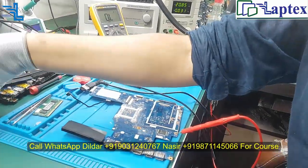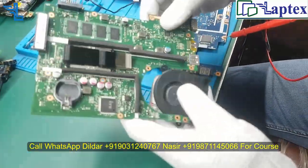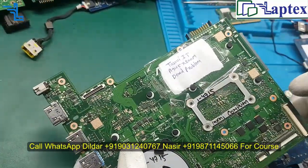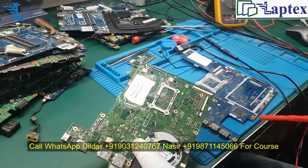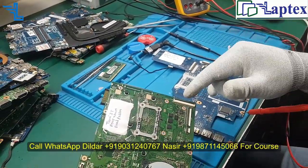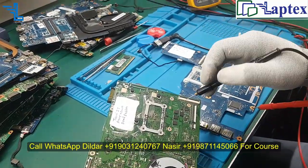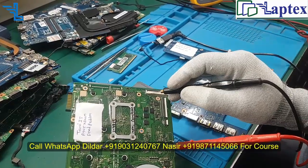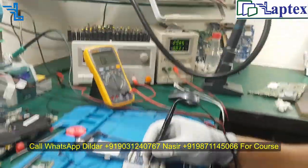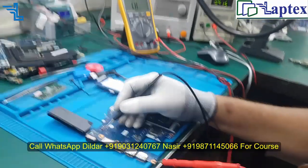Here I have an ASUS motherboard — possibly a mini motherboard. The difficulty here is that you have the DC jack on one point and the on/off will be on a daughter board where the on/off switch is located. So how will you turn on this motherboard? In order to turn it on, you should avoid using tweezers. Instead, hold the red probe on the ground and keep touching it this way. That is a good method to check whether it is turning on or not. Using the same process, I touch it and — you see — it turns on. The same process also turns it off.